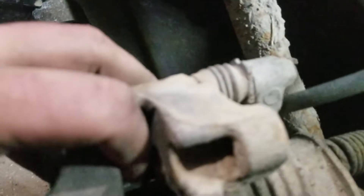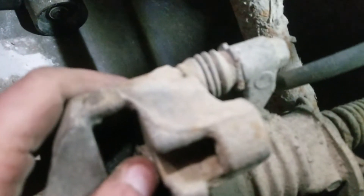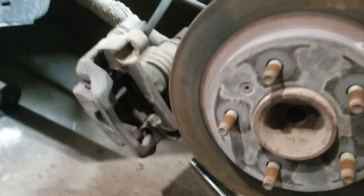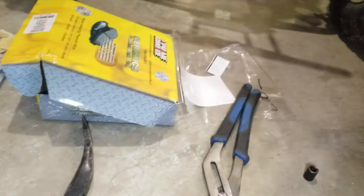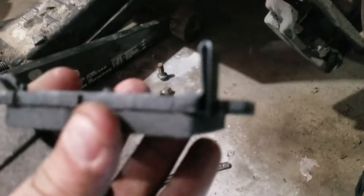I'm in Canada as well, so sometimes it makes a difference. You see these little junky pieces in there — I hate those clips so much. You want to make sure they're fit right where they should be, or you might have a pain of a time getting those things back in place with the new pads. Then you fit your new pads in place as well as you can. One of them has an indicator on it, as you can see there — that just lets you know when the pad is down to a certain amount.